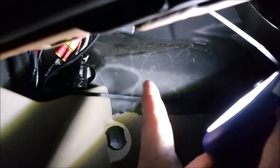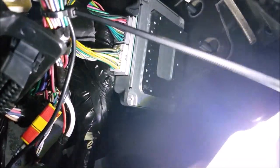It's going to be very difficult to see how I fed the wires up through here, but you might be able to see the tails of the zip ties and kind of see the path that I followed. I basically went up through this kick panel. The lever is right there, up through here, around the OBD port and behind there, and there's a wiring harness that pretty much just followed that up through this big old hole in the dash, bottom left there. There we go. Fit it right through there.